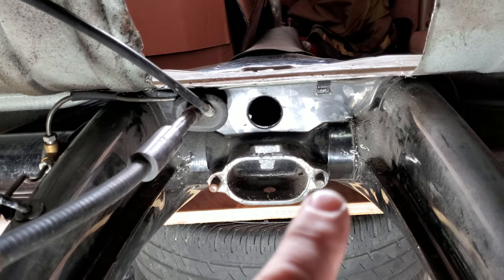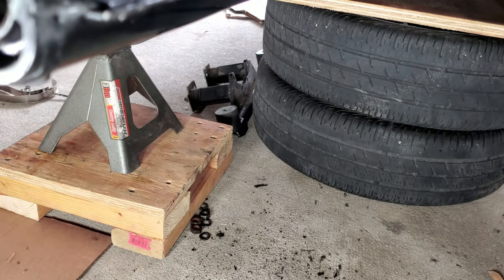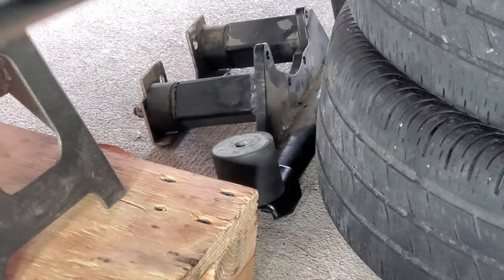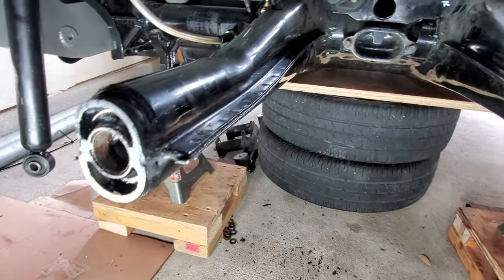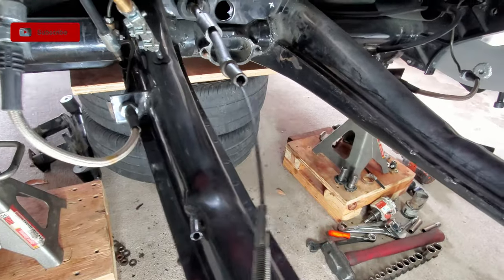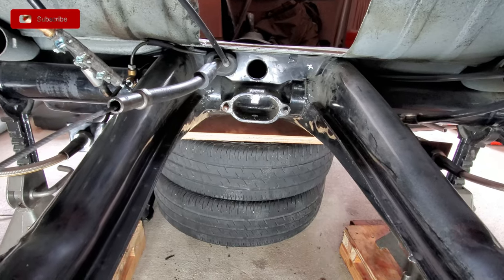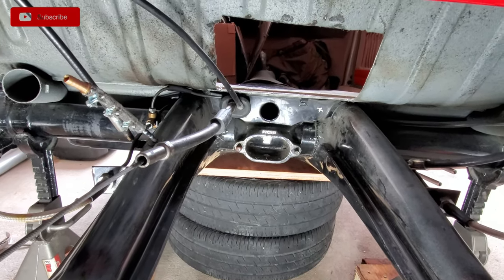Also over here, in the torsion housing, there has to be some clearancing as well. You can see I've got my Berg 5-speed mid mount down on the ground over here, just chilling out. That's going to be waiting for the new nose cone to get here before I can clean up the frame horns and weld in the brackets, because I want to make sure that everything fits the way it's supposed to fit. And you got to wait until you got the nose cone here and know what I have to clearance. So what are we working on today?